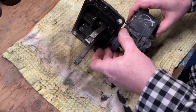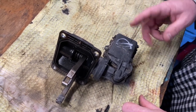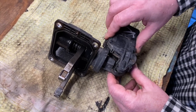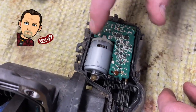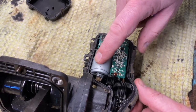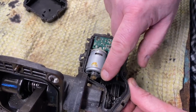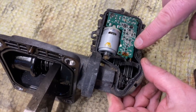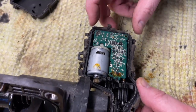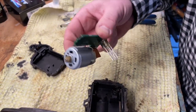So we've got the old actuator here on the bench and I'm going to take a look inside. Pretty hokey setup for a big one-ton truck — a lot of plastic. I took the tabs off, pulled this apart, and here's your setup: a little 12-volt motor and lots of plastic gears. When the actuator is called to go to four-wheel drive, this motor gets energized and through gear reductions moves this fork over. Looking at the control board you can see a lot of corrosion — it's a harsh environment underneath the truck with road debris, water, and stuff. That's pretty much your failure point right there.